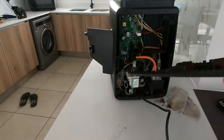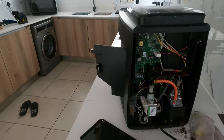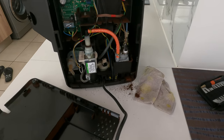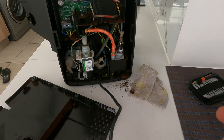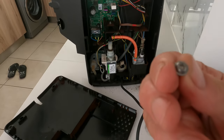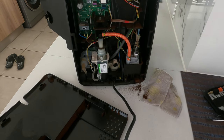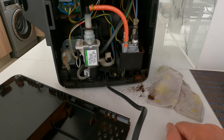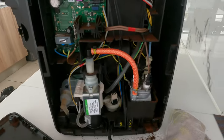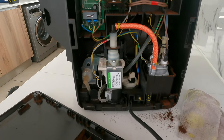I've removed the back of the coffee machine by removing two screws — it's a Torx screw, the one that looks like a star. Since I also fix computers I already had that screwdriver, so it was fairly easy to open. You can see there is a lot of mess from coffee at the back of it.